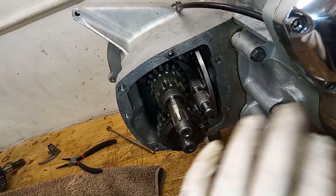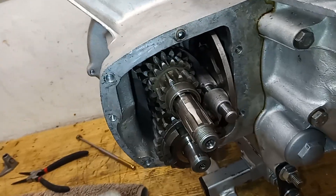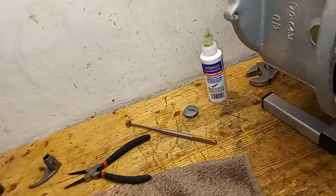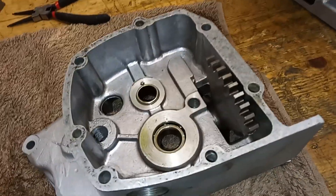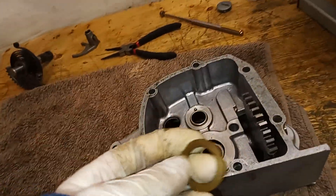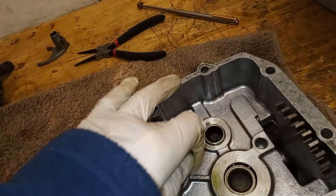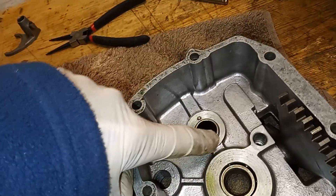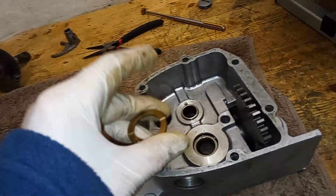Now we're going to put the inner cover on, and we need it in first gear - very important. What I'm going to do is put well seal all around the casing and around the inner casing, getting ready to put the gears on. Then, like I did at the other end, I'm going to glue this thrust washer on by putting some globs of grease on the back and putting it around the needle roller at this end of the layshaft.